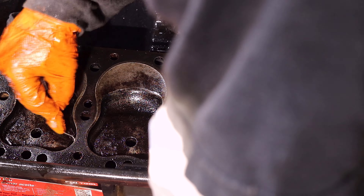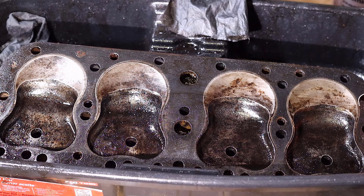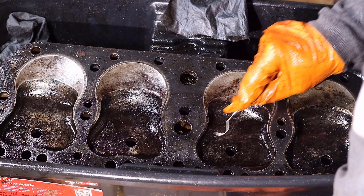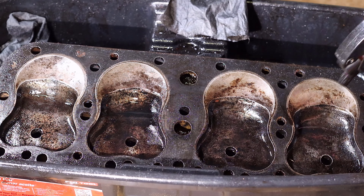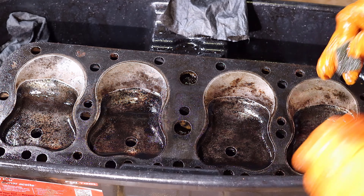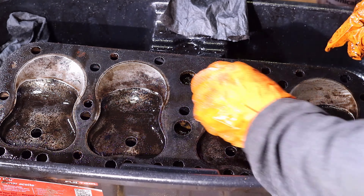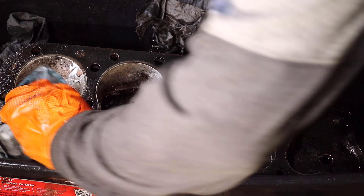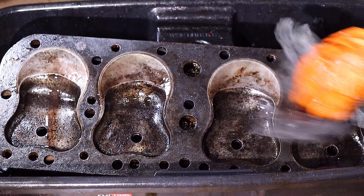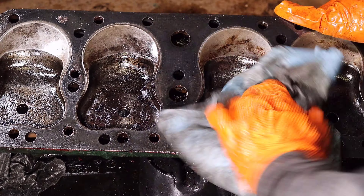In this view the cylinder head is sitting in the oil drain pan. Looking at this view, because the engine head is not very tall, I wonder if soaking it overnight in a couple inches of Marvel Mystery Oil would have helped to remove more carbon. As seen from the progress on the engine head you can start to see some of the smooth metal surface beneath the carbon. Since this process of removing the carbon was so long, you start to wonder — I wondered if this engine had ever been rebuilt or how many times over 80 years the carbon had been removed from the cylinders, and how many years it took to build up the carbon seen at the beginning of this process.